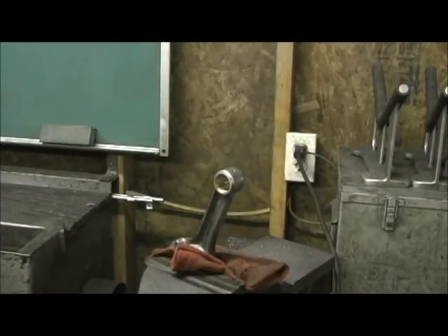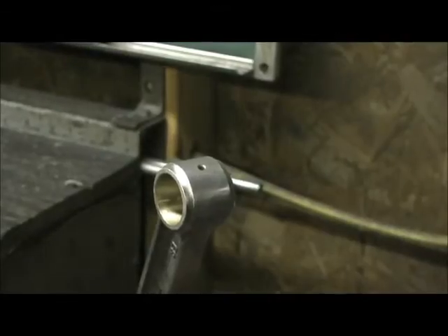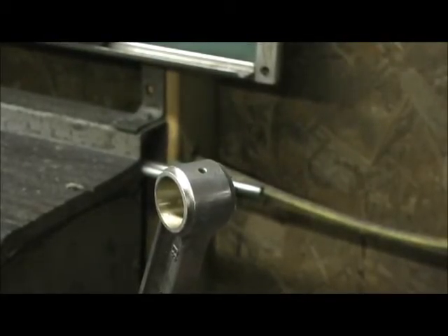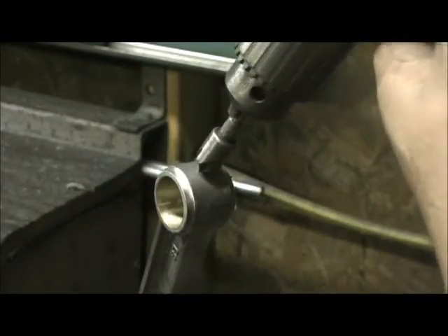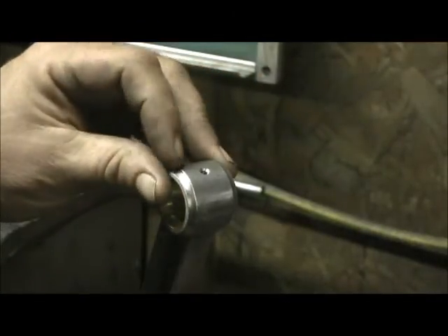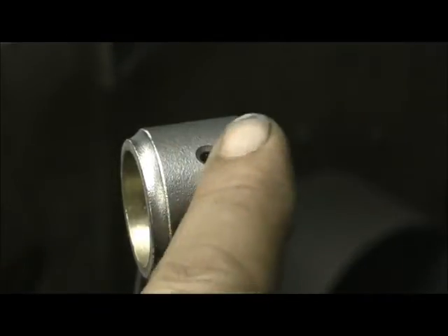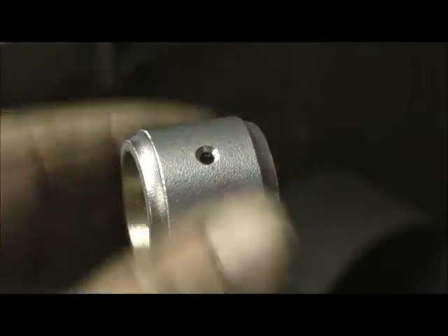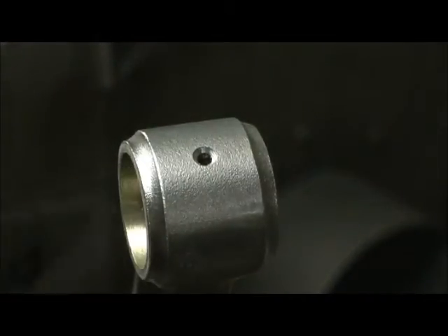Now there is another trick you do to these rods, and this ain't just Eagle's fault — a lot of rods over the years come like this. All I'm doing is taking a countersink right here and just lightly opening that up a little bit, just to put a little bit of radius in it. That's for oiling — it opens it up a little bit, then I'll take a drill bit and just run through just a touch to make sure it's clear. Putting a little bit of radius or countersink makes all the difference in the world — it gives it a little funnel to expand out oil for its drip process.